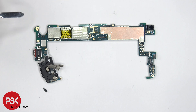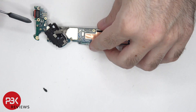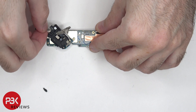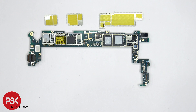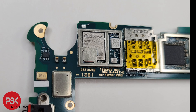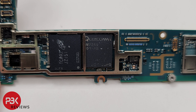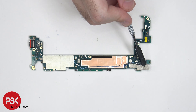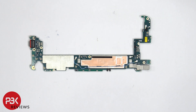There's a white coaxial cable connecting the speaker assembly to the bottom of the motherboard, which can be disconnected by just popping it off. Once the shields on this side are removed, there are rubberized thermal pads or thermal paste on top of the processor, RAM, and the chip. On the back side of the motherboard, there's more copper tape on top of a shield, a coaxial cable running over it, and the front-facing camera connector with protective tape covering it — that can be disconnected by peeling off the tape and popping off the connector.